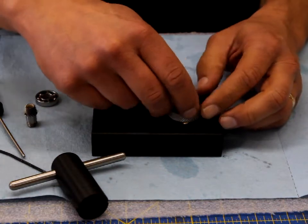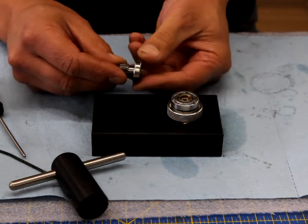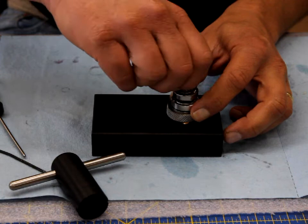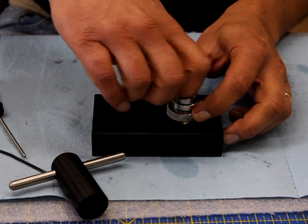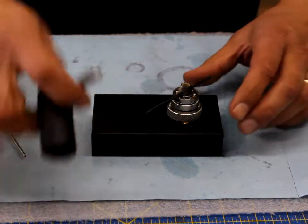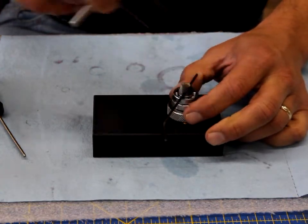Once we have this assembly back in the tool block, we're ready to take our main bearing and our pinion. We'll slide the main bearing right onto the pinion, then screw the pinion assembly back into the clutch housing. We're going to screw this down counterclockwise — remembering that's left-handed thread. We'll place the allen key through the holes drilled in the pinion and then, using the pinion wrench, tighten it in a counterclockwise direction — nice and firm but not too tight.